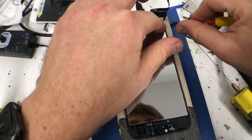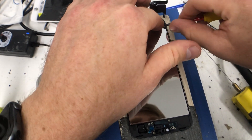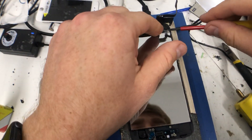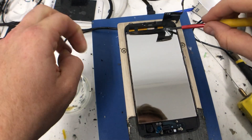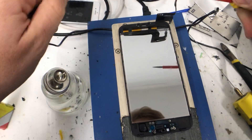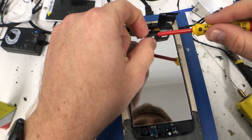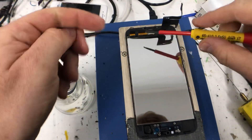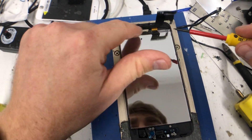What I would do after this is clean it and fit the backlights. I'd put it in the laminar flow hood or whatever dust-free area you've got. I'd use acetone on a white lint-free cloth and clean the back of the mirror polarizer. The edges where the black adhesive was — as long as it's not encroaching on the display area, it doesn't need to be perfect; just remove any clumps of glue. The new backlights have black adhesive around the edges. Once it's clean, peel the plastic protective layer off the new backlight, place it on the back of the screen, solder it, and it would look normal again.